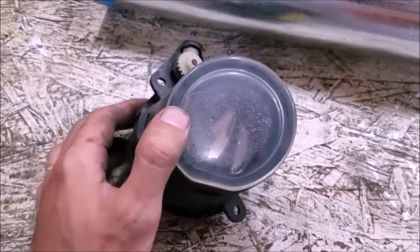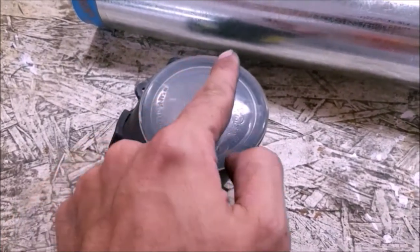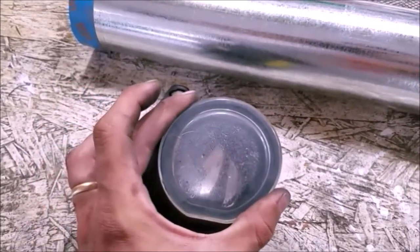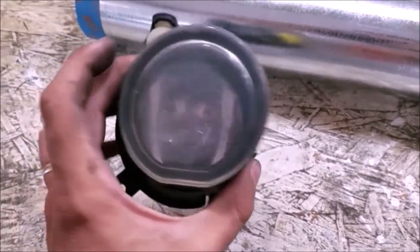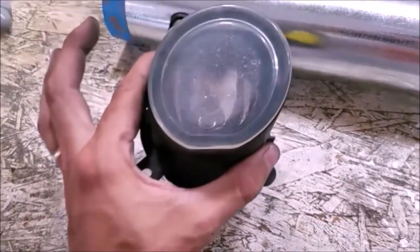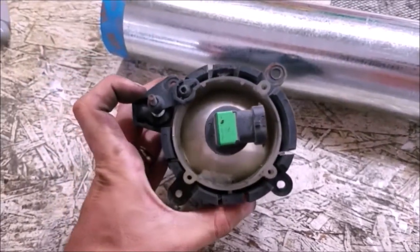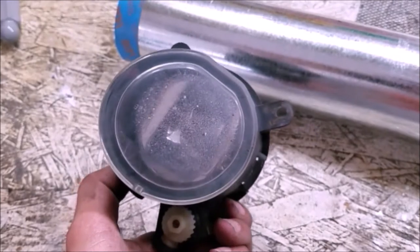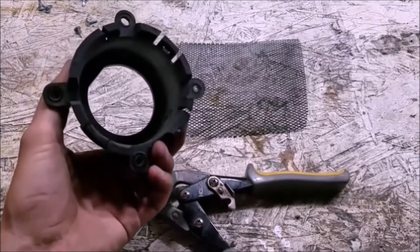After that, getting the lens out — imagine almost like a windshield or any fixed window, it's sealed all in here, so getting it out is kind of difficult. I basically had to destroy it. If you don't want to destroy this and want to keep it for later, you can always buy a block-off plate — it looks exactly like this but it's black plastic, and you can drill a hole in it with your hole saw and do the same thing, bolting it in using these factory mounting points. Both sides only used three of the four holes.